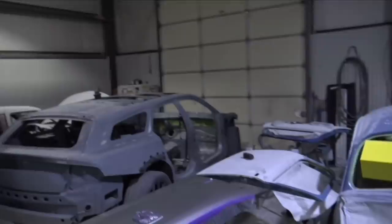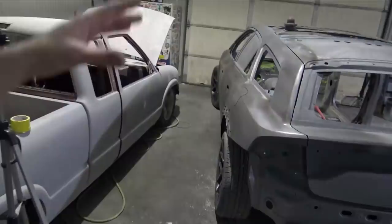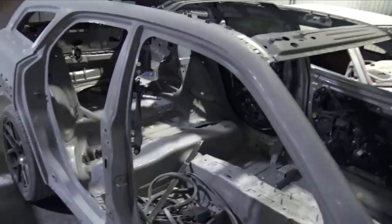I try to get everything scuffed — as long as it's nice and dull, that's really what you want to see. If it's still shiny you may have issues with paint lifting, or if you have a sticker and you peel it off — as you've seen with people who wrap their cars and get a big chunk of clear come off, that's what's happening. I left the car outside all day, it was 67 degrees and this side seemed pretty hot. We'll get this all blocked out in the next video. I'm also going to start working on the interior — I have everything I need, just need to dry all the sound deadening out of there, prep it, and spray it. Then we'll be ready to paint the outside of the body, which I can't wait to see.